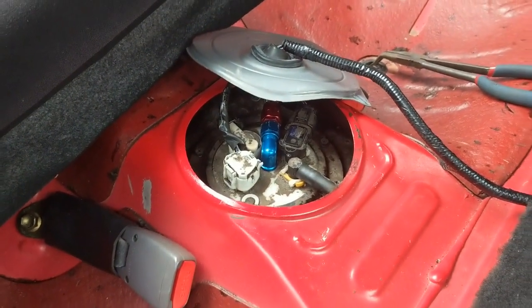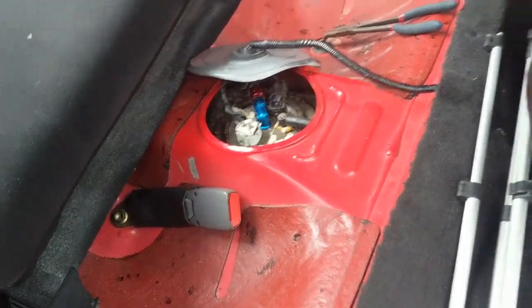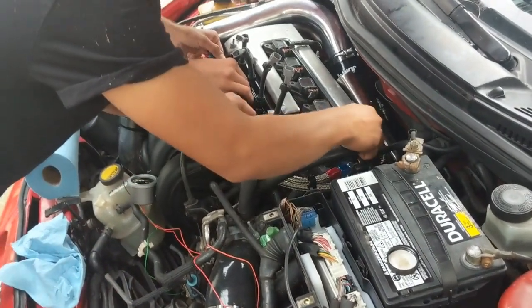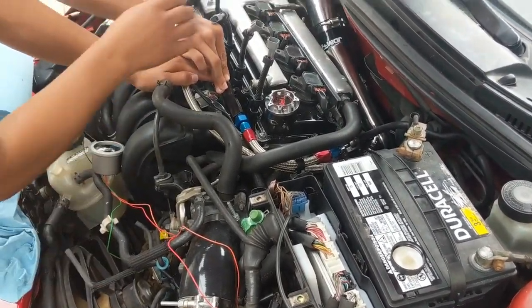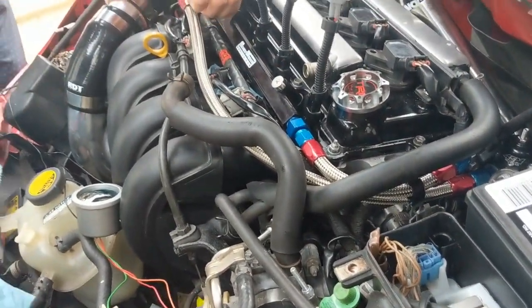While we were priming the oil stuff, I disconnected the lines going to the feed and stuff in the fuel assembly - I disconnected it while we were priming and didn't have to pull a fuse. Now we're just going to prime the fuel stuff and make sure there's no leaks because we're ready to start. Fuel is dangerous, and it's going to be more dangerous running E85. Right now when we were priming the fuel system, we just had the fuel rail leak fuel everywhere. Luckily that's the only thing - at least from the fittings it doesn't look like we leaked anything.